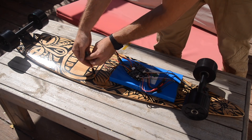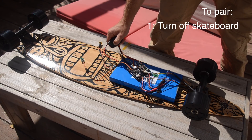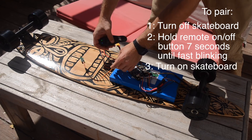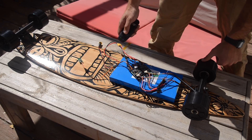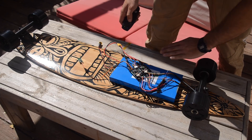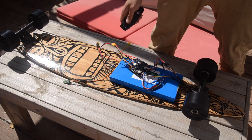It's hard to see in the bright sunlight, but the flashing LED on the receiver tells me it needs to find the remote. To pair the remote to the receiver, make sure the skateboard is turned off first. Then hold the power button on the remote for about 3 seconds to turn it on, then keep holding it for another 4 seconds to get the blinking lights on the remote that show you're ready to pair. Now simply push the on button on the controller to turn on the skateboard, and the receiver should instantly pair to the remote, making the LED on the receiver turn solid. Push the button on the remote up slowly to engage the motors and check that they're spinning in the correct direction. Mine were actually spinning backwards, which means I plugged each motor into the wrong controller. I just needed to unplug the motor wires and plug them back into the opposite controllers. Now my motors are spinning in the correct direction.